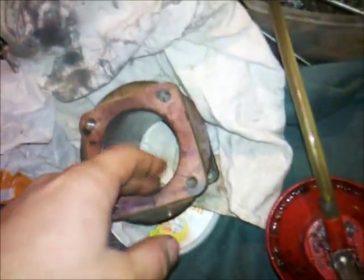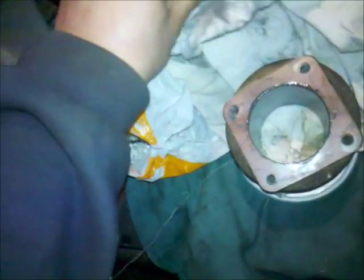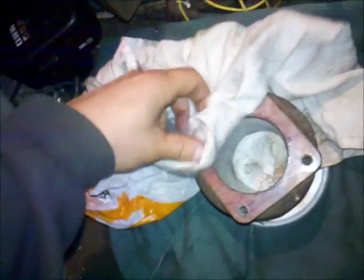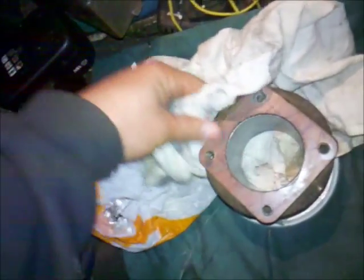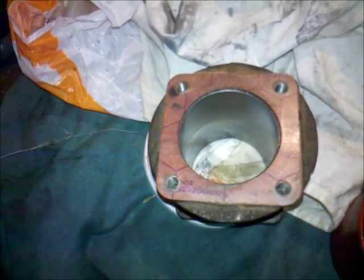Now, the big challenge comes. How to assemble the piston and piston rings onto the cylinder bore. On the big engine, the Perkins engine last year, that was not such a big deal, because the pistons and connecting rods were not connected to the crankshaft. But here it is assembled to the crankshaft, so I have to slide the bore over the piston, and not the piston into the bore. But I guess we will accomplish that also.